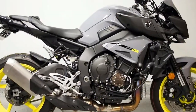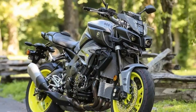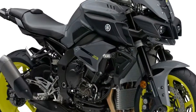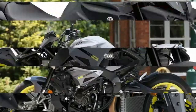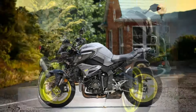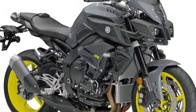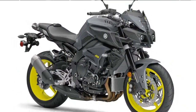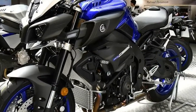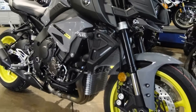The song is the same, but the power character and response are quite a bit different from this half-naked sit-up street bike. The changes are really about long operation. Starting with the 12-liter airbox versus 10 liters on the R1, Yamaha says the extra capacity helps performance on the FZ10 because it doesn't have the same available ram-air effects, since speeds on the FZ10 as a street bike are generally lower, and there isn't a full fairing with an enclosed intake channel stuffing air into the airbox. It also could have an ergonomic inspiration — a larger airbox simply fits better on a bike where there is little need for the rider to tuck in.